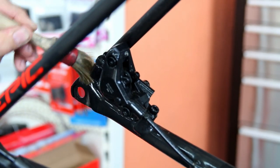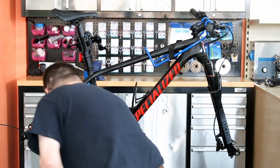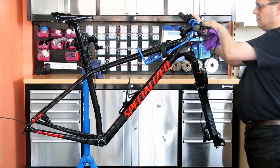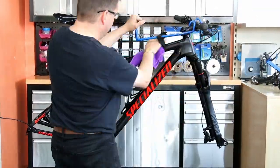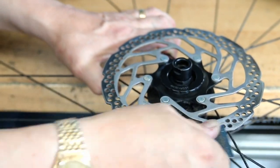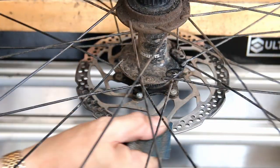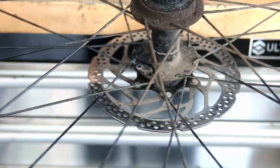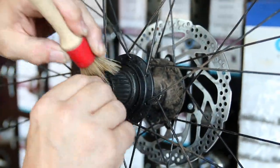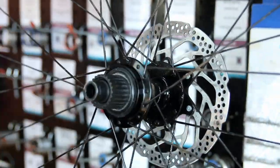I'm washing down the frame again — it's a good point to get tactile with the bike, checking things like derailleur hangers and little clips. The forks had a clip holding the pipe I'd shortened, and where it had that kink the clip had popped out of its recess, which I sorted out along the way. Then I give both sides of the discs a rub-down to take out the little lines that accumulate and cause squealing.